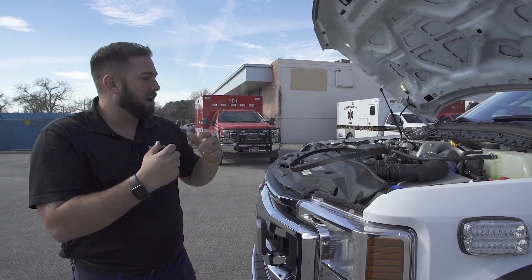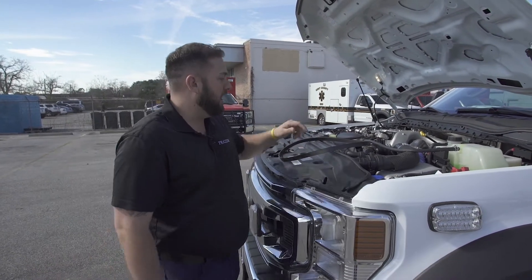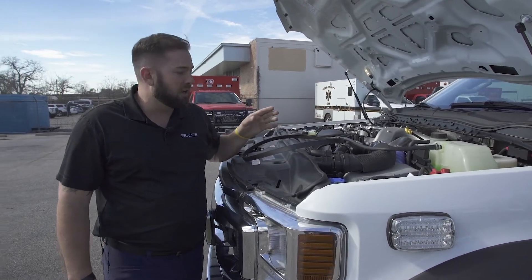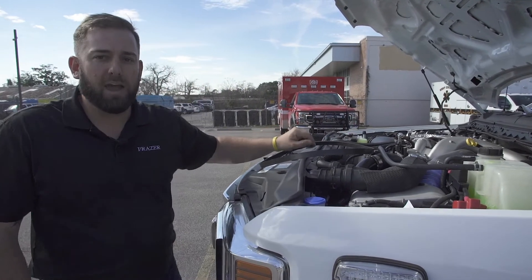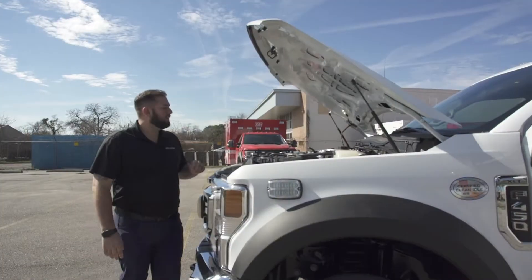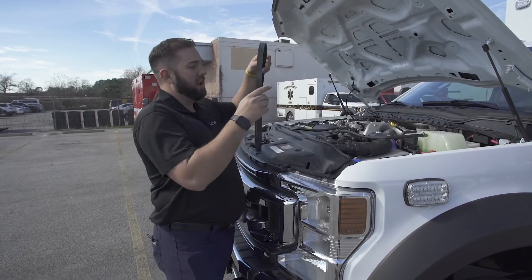Take the good spare off the shelf, install it in the truck. But before you reinstall it, you're going to do a couple of things: inspect the bracket that the generator sits in — it's just a visual inspection. Look to make sure nothing looks broken or damaged. It's a welded steel bracket, so you'll want to visually inspect the welds and make sure they're not cracked. You also want to inspect the pulleys and make sure everything looks tight.